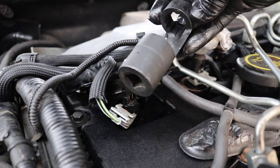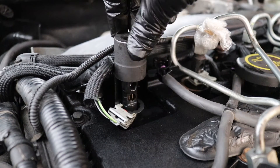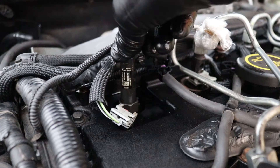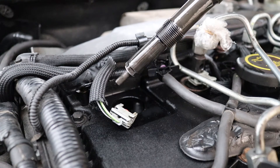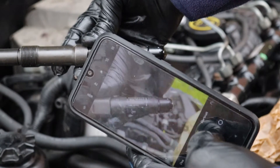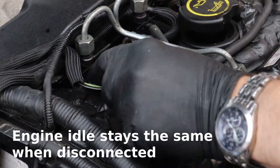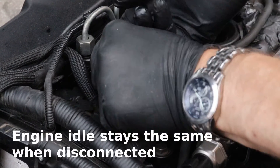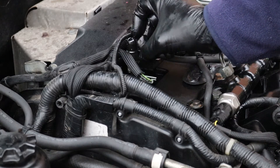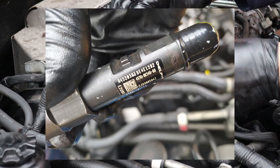In a previous video I showed you removing the old injector from the cylinder head using a special tool, commonly known as an open-sided deep socket, 21mm, and then refitting the new injector after a simple process of elimination with the electrical connectors. I ascertained that the number one cylinder had a broken solenoid and didn't work, so I sourced the new injector, jotting down the new code — which is a 16-digit character code printed on the side of the injector — and correctly installed that.